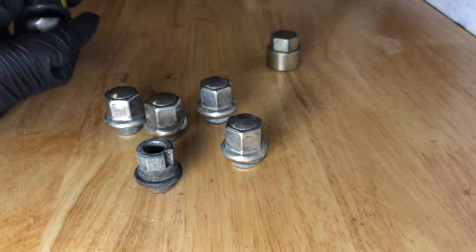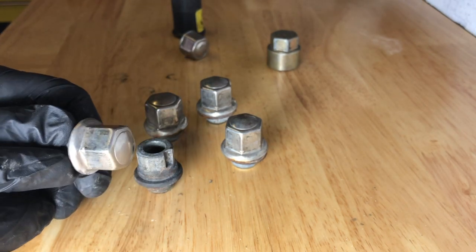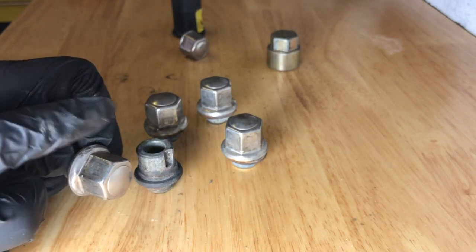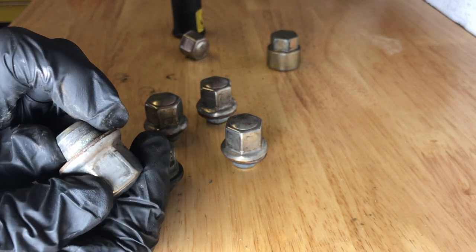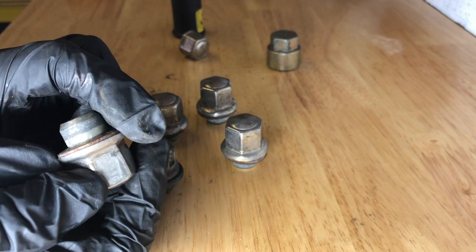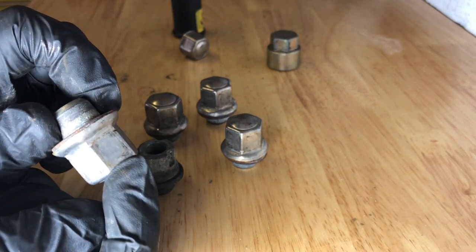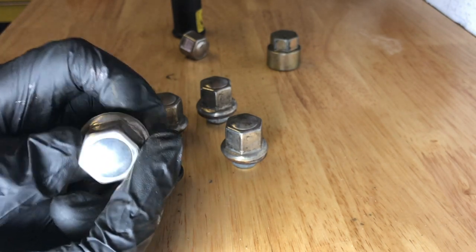We've had a few people say they can't get the covers off the other wheel nuts. These are not covers that are removable. We've had people think that they've got locking wheel nuts on every nut because they can feel a movement on the head relative to the thread. Obviously this ring is often loose, the seating ring. There you go. But they can feel this move when the wheel nut is tight. Therefore it's a cover and it's got to come off and we can't get it off.